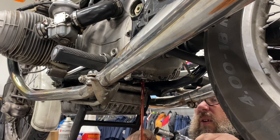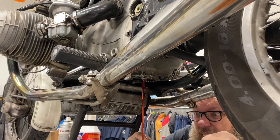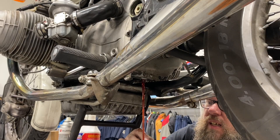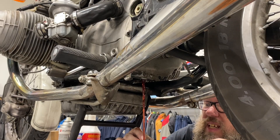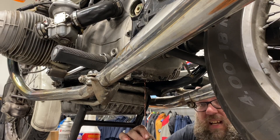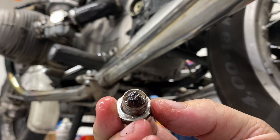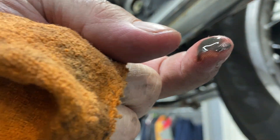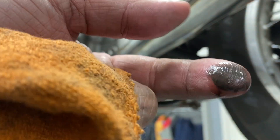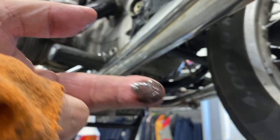So you want to eyeball your oil as it comes out. And you can see this is red — it's just the brand. It looks nice and clear, which means there's probably nothing wrong with my transmission, and I probably could have gone another maintenance cycle without changing that oil, but better to change it and not need it than need to change it and not do it. This is the key on the transmission — a magnetic drain plug. You look at the end and you want to see a paste, if anything. That's all that is — just a little paste. There's no splinters of metal in there, which would be bad, because that would mean my transmission gears are starting to come apart.